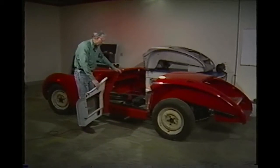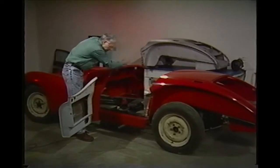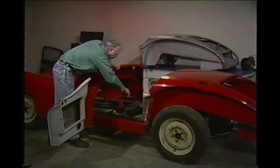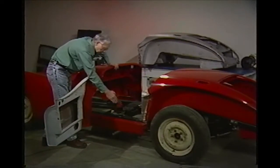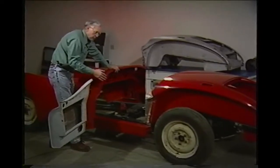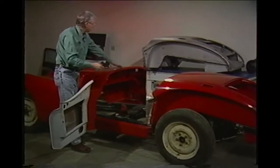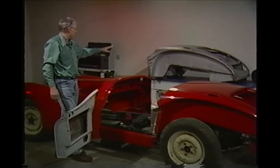What we used to do is take the bodies off the frame and cut them in half. You had a steel rocker here, a wooden floorboard and a steel tunnel, and a rocker on the other side, so it was easy to cut the bodies in half. The reason we did that is because we could send the rear or the front to the strip tank separately and get it clean. That way we wouldn't have a lot of bare metal laying around.